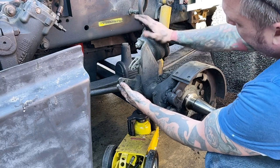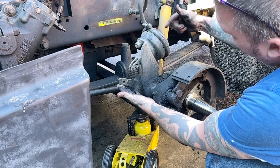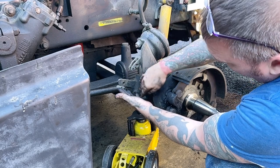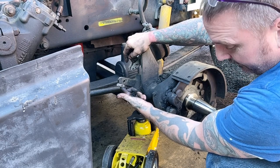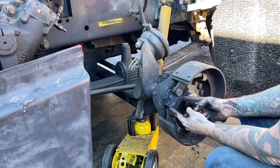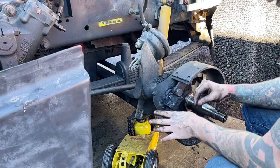Now, you might get 60 to 90 pounds of air pressure in here, but because of the size of this diaphragm, that increases the PSI that this plunger comes out with. And then because this is a 90 degree lever, that multiplies the pressure from this out on this point. And then as this ramps out, these shoes go up against the drum, and that's how your brake works.